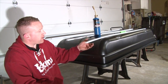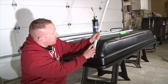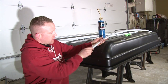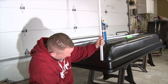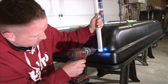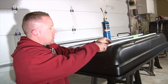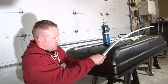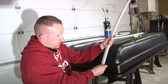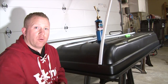The first thing you want to do is take your hi-fax, and you're going to want to set this on the top or the front lip of the sled, and you want to make sure that it's lined up with the ribs. You're going to have two on the ends and one on the center. So we're going to line this up, take our 3/16 inch drill bit, and drill a hole. Now this is where it's going to be nice to have that extra person. We're going to take our screw, insert that into the hole, tighten this one down, and then bend it over and keep going.